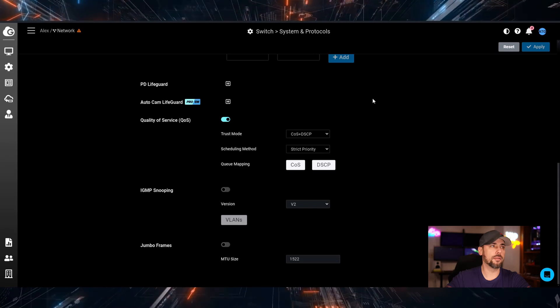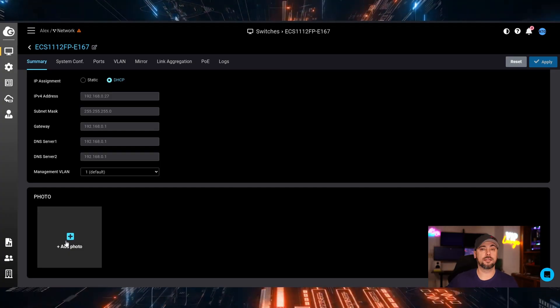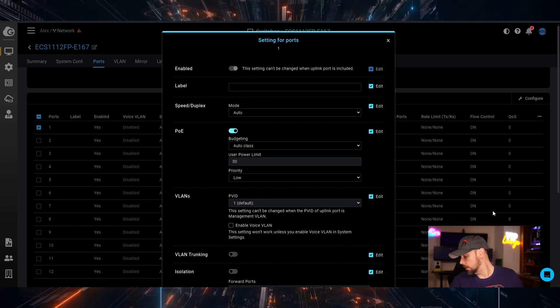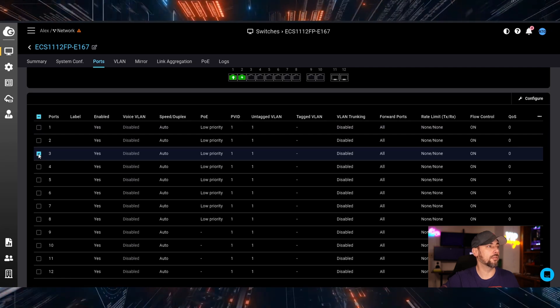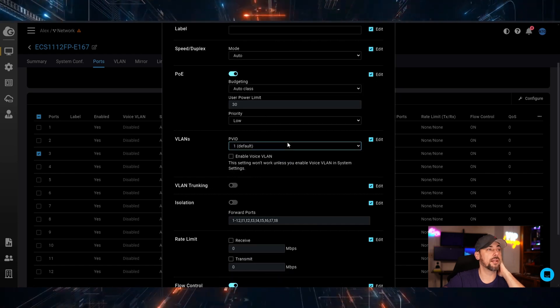The default SSID has no password on it — wide open — so we'll set a password and hit Apply. All the things you'd expect from a wireless controller are here. There's also a cool feature where you can attach a photo to a device, so if a switch or AP is at a remote location, someone using the app can look it up and see that exact switch. You can configure individual ports — label them, disable them entirely, or dedicate a VLAN to a port — which is exactly what you want.